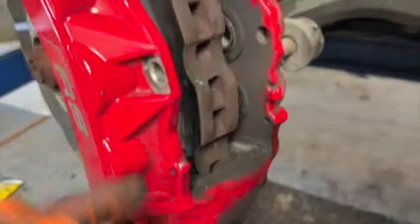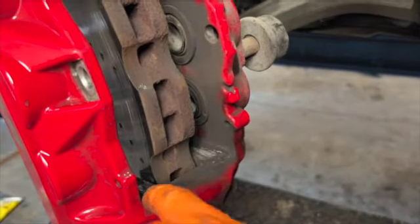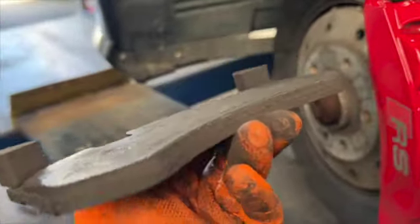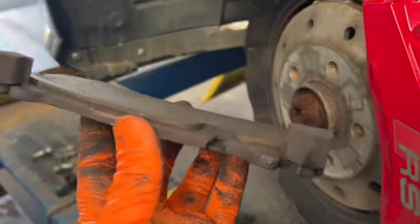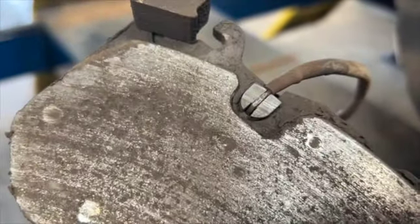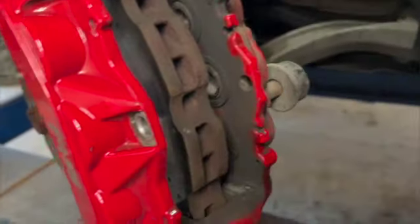So as I said, the little bolt that goes in the back — undo that, get the main bit out, tap the two pins through, then gently push these back, clean up the mating surface where the pad goes, and obviously disconnect the sensor wire which we've already done. We've got these pads — the sensor was flagging on it so we got them in good time so it doesn't actually cause any problems. You can see it's just cut the sensor there, so excellent timing.